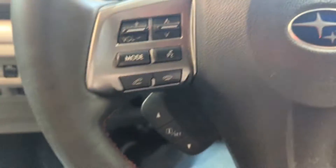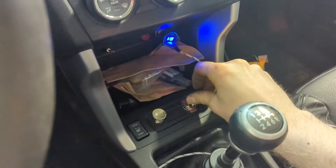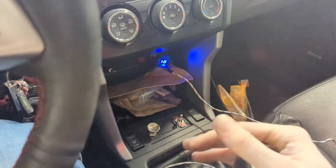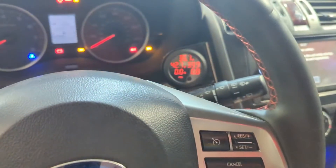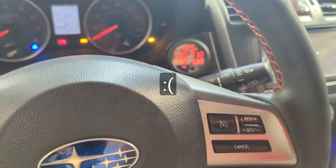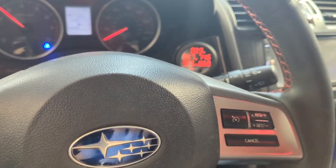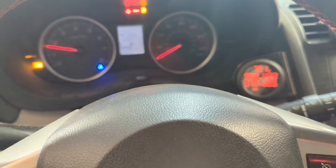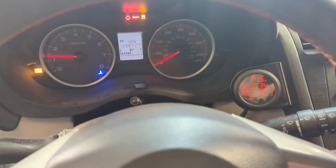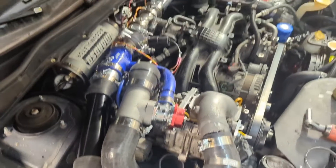Curious to see if the O-ring or any of the additional tension makes it hard to operate. So let's listen — I can hear it, it stopped. Open it. Let's see if it can start — supercharger off. Still guessing we have an extremely lean condition and extreme fuel trim.